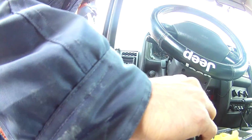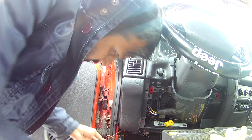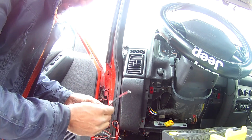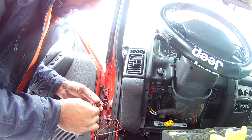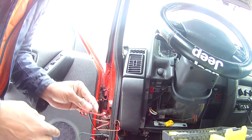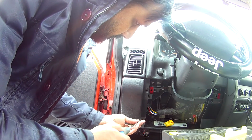So that wiring is done. Well, not exactly the wiring, inserting the wiring is done. So now you have the positive and ground for the receiver, and positive and ground for the screen, and you join both of these and you need to connect one to the ground and one to the power. So that's what we need to do next. Let me leave this here for now and put the screws back.